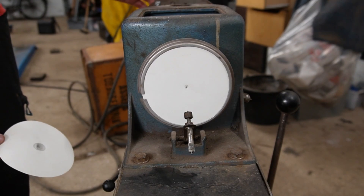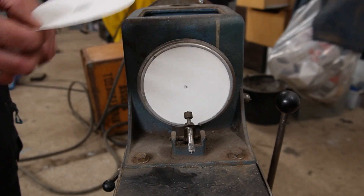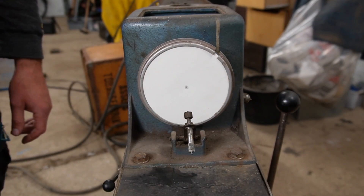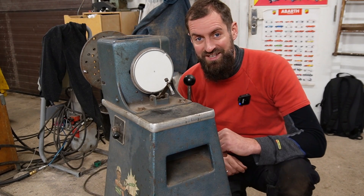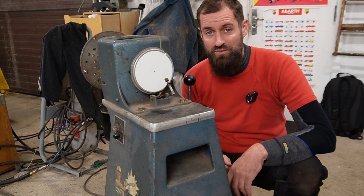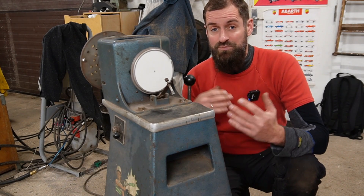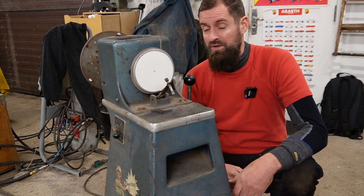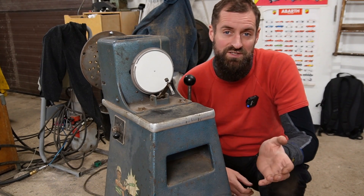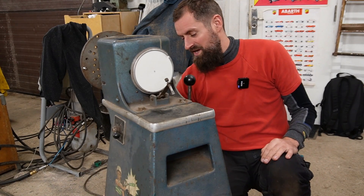This tells me that the machine at least is doing what it's supposed to, but I can't really use this test for too much because I'm not using it right — I'm not doing the static balancing before testing. But now I know that it's at least not making a cardioid without anything on it, so I know that the machine itself is in balance. Anyway, I just wanted to show you how this machine looked on the inside and do a little test to see if the machine even works. It's pointing in what seems to be the right direction and it seems to be working just fine. What I want to do in the next video is test the wheels I get next week that have been professionally balanced, confirm they're in balance, then remove the weights on one and see if the machine tells me to do the same as the professionals did — if it's telling me to put the same amount of weight in the same placement then I'm happy with this machine for sure. Thank you for watching and see you in the next one.